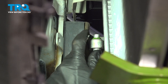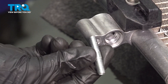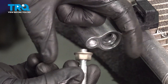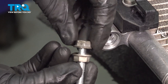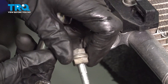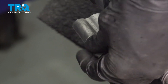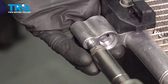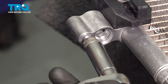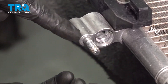It's a good idea to press the O-ring all the way onto the line as far as you can. Before you continue putting in your brand new air conditioning condenser, you want to make sure you put in each of your studs — you're going to want one in each one of your ports. To install these, take both of your mounting nuts, one from each line, put one on upside down and the other one directly against it, and then snug them together. Slide it in and start it by hand, then snug it up. Once you have that bottomed out, hold your nut with a wrench, loosen the other with your socket, and then remove the pair. Do the same to your other AC line port.